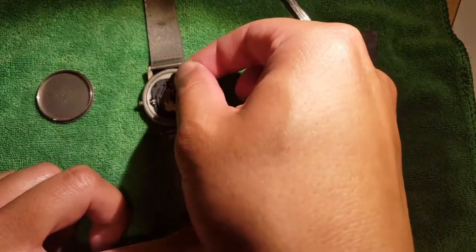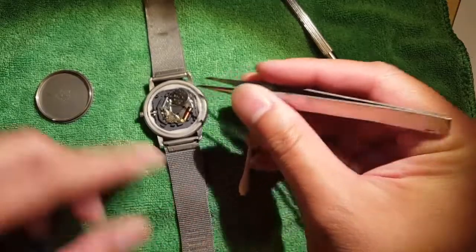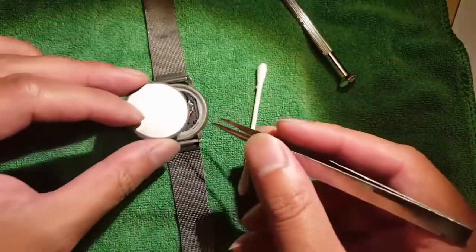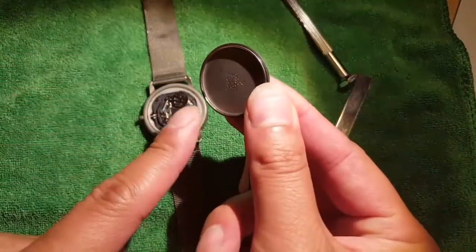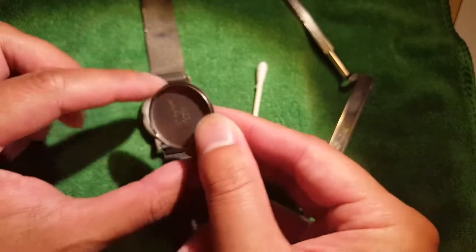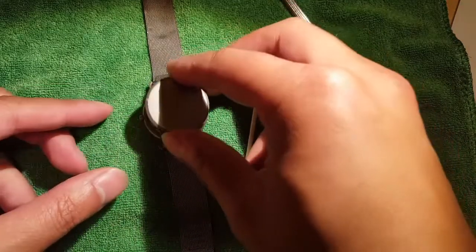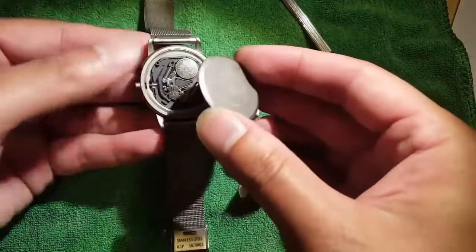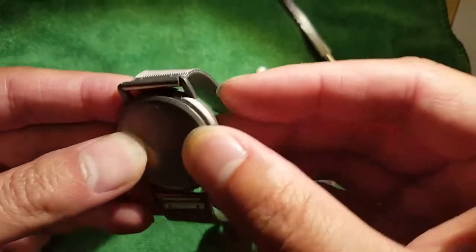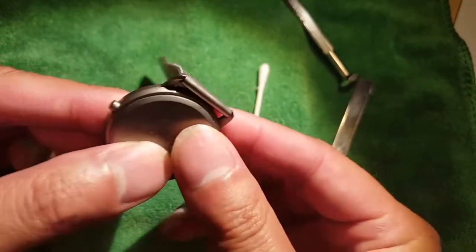So I ordered up another battery and put it in. This is a 371 battery, or if you go with Maxell, it's the SR920SW. You just use your tweezers and put it back with the lettering facing up on top. Take note of that notch — the notch goes over the dial, so make sure you align the dial with the notch, which goes back to about two o'clock or so. Just place it right over it, make sure everything is clean around it, put light pressure, make sure everything is aligned before you squeeze it in, and it pops right in. Pretty straightforward and simple — not hard at all.